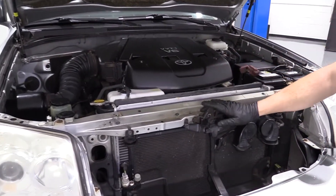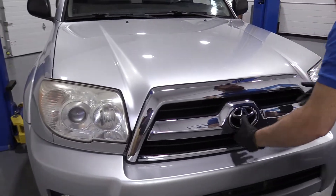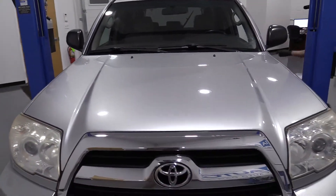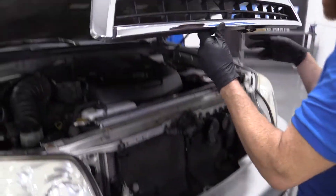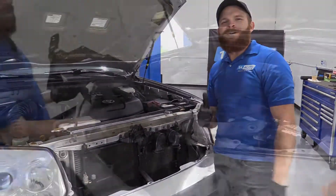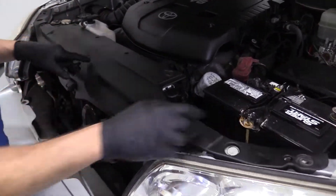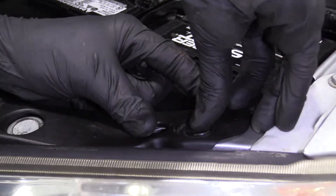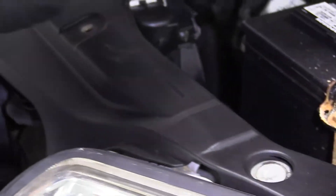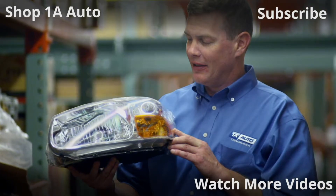Make sure we don't have anything in the way. Let's try closing the hood and reopening — oh yeah! Grab that outer plastic, up we go. It's time to get this back on. I'm going to bring it right over and press it down on top of where it's going to go. You can see where all the holes line up — we've got 11 holes. Take some of our little clippy-doos, lift up the center part, start it in the hole, and once it's in, press it down. We're going to do the same to all 11. Thanks for watching — visit 1AAuto.com for quality auto parts shipped to your door, the place for DIY auto repair. If you enjoyed this video, please click the subscribe button.